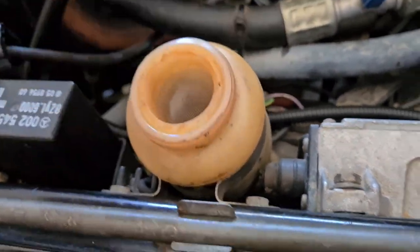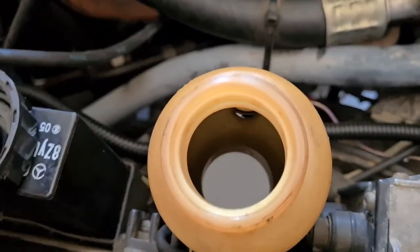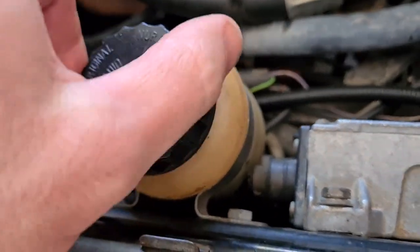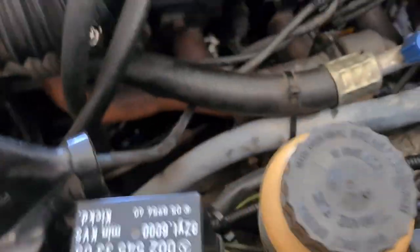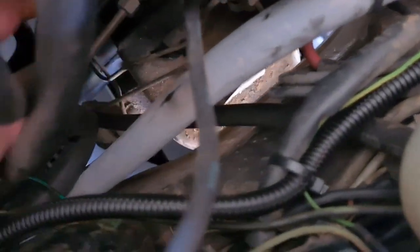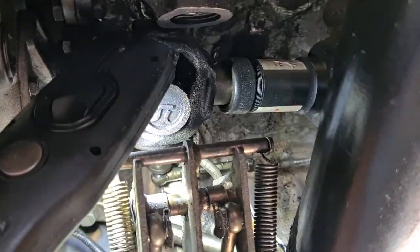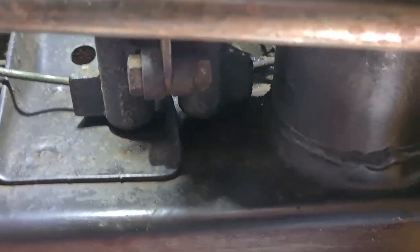There's a deficiency of fluid but that's not the cause of the problem. I couldn't find much info on this, so if it's of help to anybody, here's a brief overview of the system. From the brake reservoir, the flexible tubing goes down the left side of the vehicle and then joins up to a rigid brake line below, as you can see from the underside. They run to just behind the transfer case.